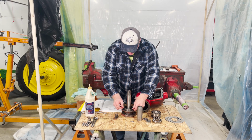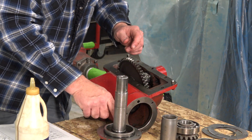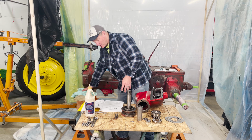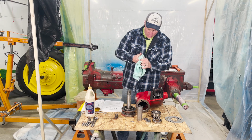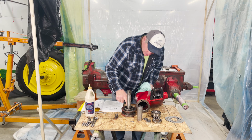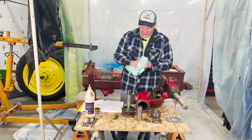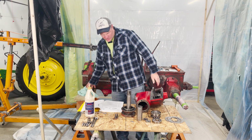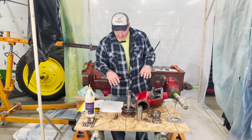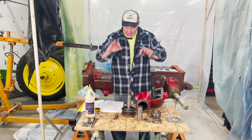And I'm pretty impressed with myself on this for having to make those. I just bought an O-ring kit that allows you to assemble your own O-rings. It sends you a bulk length of O-ring in various sizes, and it sends you a little jig with it. What you do is you put it in the jig, you cut the end square, and you actually take and glue it together.